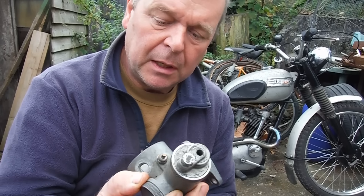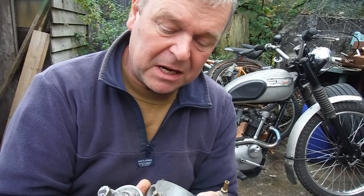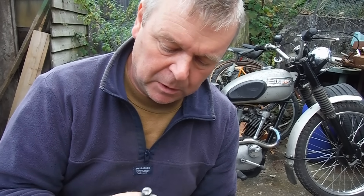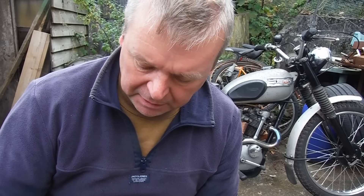I think that was one of the first occasions where I actually went up a size on a needle jet. In Amal carburettor speak, about 90% of the carburettors I've encountered have always had a 106 needle jet in them. I decided I'd go up to a 107. I put the 107 in Slowpoke, went up the road, came back down — the pinking was gone. And ever since then, in quite a few cases, I've increased needle jet size rather than main jet size, or sometimes maybe both. Left the ignition timing as I thought it should be, and I've had great results.